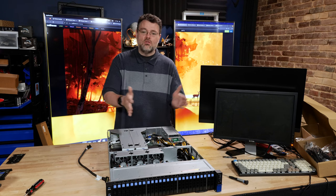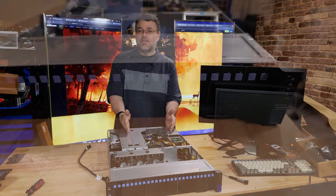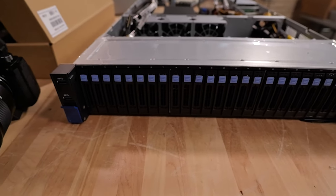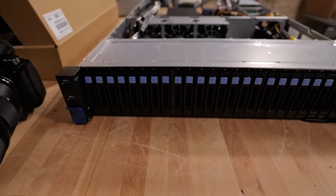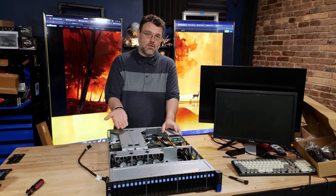And you want to go multiple systems before you go even higher end single system and build a cluster for redundancy. Having this much fat and wide storage at the front means that your database server can do all of the lightning fast operations that it wants, and then it can return the data set at a relatively slower speed over the network. And so this is sized appropriately for that.